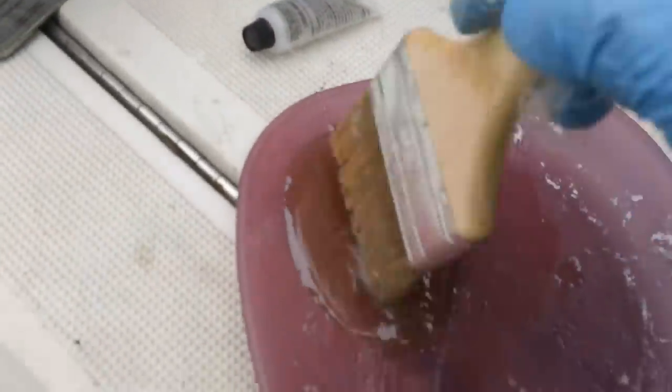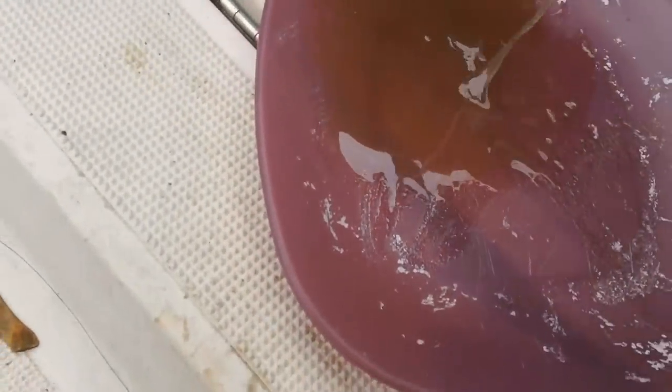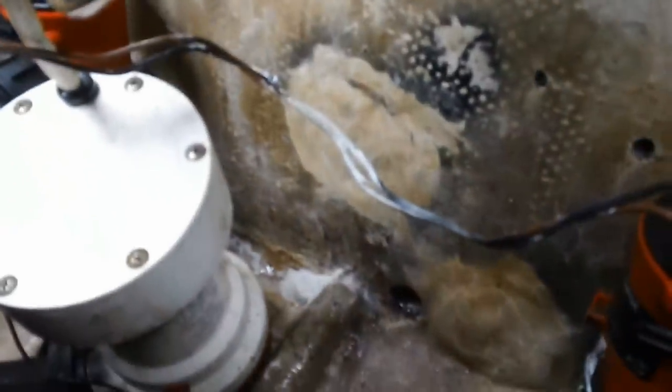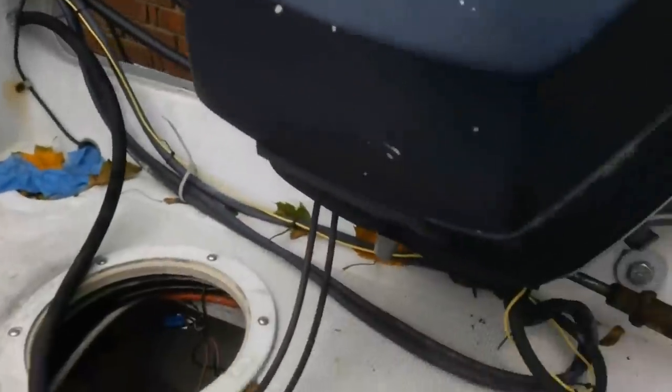Here I have some fiberglass resin and a couple of drops of hardener, mixing it up with a regular cheap paintbrush. Since I never know what to use, I used 3M resin from Home Depot or Walmart. I'm brushing it on before putting the mat — just a little layer around the area first. Here's a look at the fiberglass mat done on both holes; it's a few inches all around the hole and down flat on the bottom as well. Now the holes are completely covered in fiberglass mat and resin, and I'm leaving them to cure. A tip: don't rub the brush on like paint — dab it on, and the fiberglass will go down really nice.